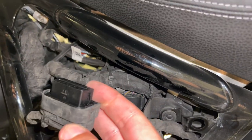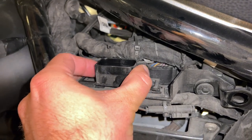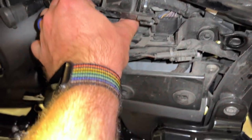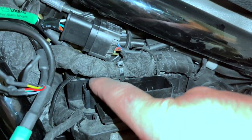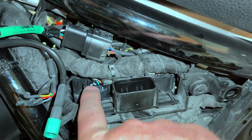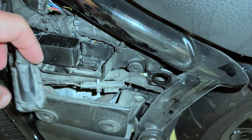Actually, all you've got to do is undo the OBD2 cable — just squeeze there and pull it out. Once you do that, grab here and slide it out, then lift up and put your fingers in. Now you can see this plug here is just going up to here — that's the old alarm port, and that's the can opener. So the can opener goes into that hole, the alarm port goes over to the other side via the passthrough, and now we slide this back into place and put the OBD2 port right back in.